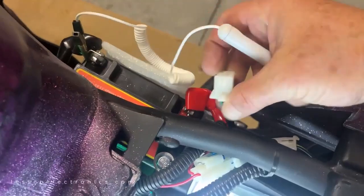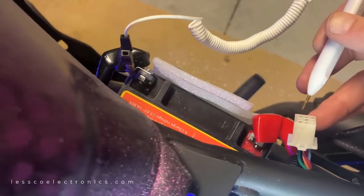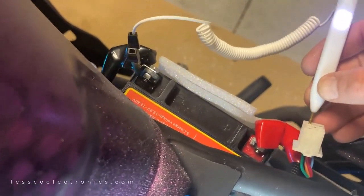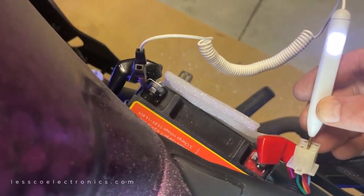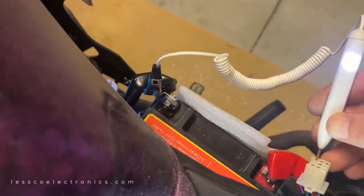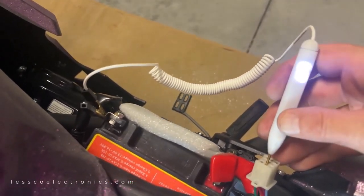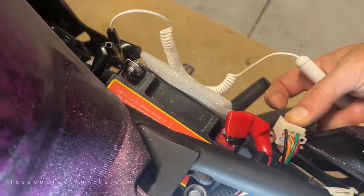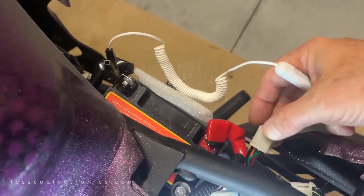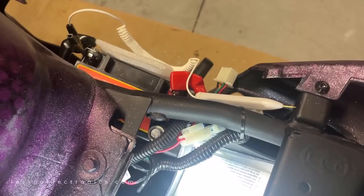But in here, most motorcycles have an extra plug here, which is designed to plug into basically any alarm in the world, from my experience. And you can see this one lights up when I connect to it. That's 12 volts, and I think the other one was over here, right? So remember, this one here and this one here both have 12 volts. Now when I turn my key off, this one here went low to ground. And this one here is still at 12 volts. So this one here, the red is my constant, and over here, my black is my accessory turn-on wire to my dash cam. Once I make those 3 connections, the rest is simple.